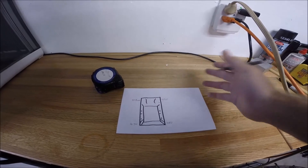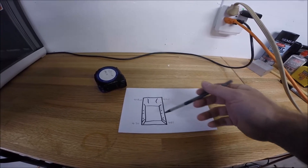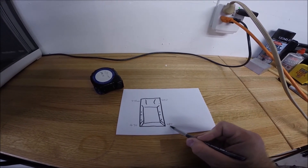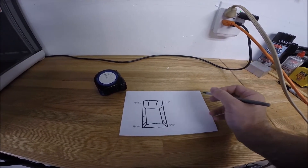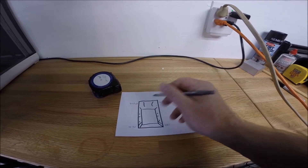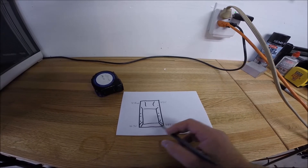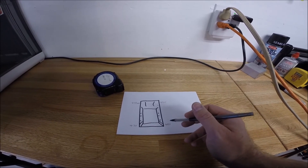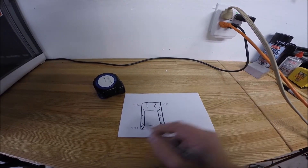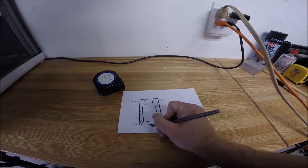We've performed the measurements on all four corners. Keeping track on a Land Rover diagram, our readings are: 498, 490, 470, and 480. About 19.5 inches is normal for this vehicle. The rear is expected to be about 10 to 12 millimeters lower, so that's about normal. The front reads 498 and 490 — not too worried about that. I'd like to level the rear out a bit; let's try to get those around 475.